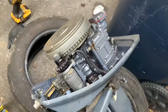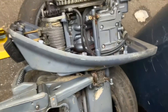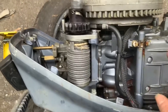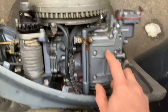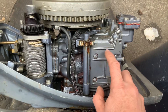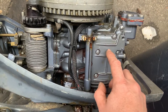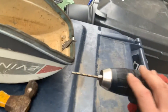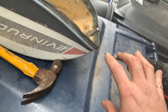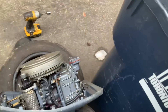Here's a 1965 six horsepower Evinrude. What I'd like to do is install a P-hole or a telltale, and I'm aiming for right there. Based on some pictures I've looked at online, there is water flowing in behind this exhaust cover and there is no obstruction back there. So you want to start small and put some grease on the drill bit blade so that you don't push any metal filaments inside the exhaust cover.